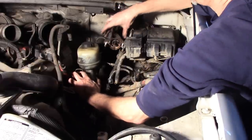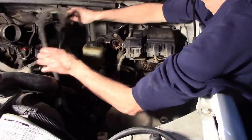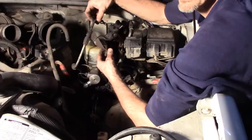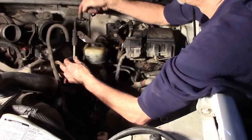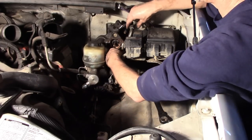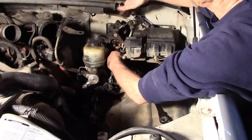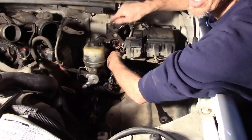One problem I ran into: in front of the master cylinder behind the nuts, there's a bracket on each one of the high pressure lines. It's kind of a catch-22 — you can't get the brackets off with the line attached, but you can't really get the line off with the bracket attached. So you have to back your lines off and twist and turn them. On one side I had to work the bracket forward to get it off the stud; on the other side I was able to twist it enough to get the bracket off the bolt. At this point I need to go under the dashboard and look at the four nuts that hold the hydro boost to the firewall and also the rod that goes to the brake pedal.